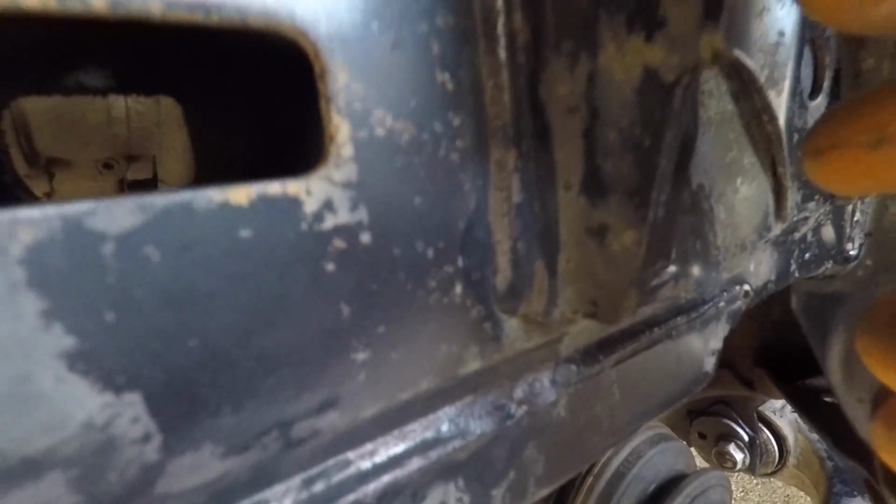There's the main weld there. All the surface rust cleaned off. And up top here, we used a little wire brush wheel on a Dremel. Now in this little bit here, all we can do is get in with these steel toothbrush type things, just to brush all the loose paint away. You can see all the flakes that are coming off there. Some of that's dust and a bit of that's loose paint and rust flakes. But these little brushes are great.